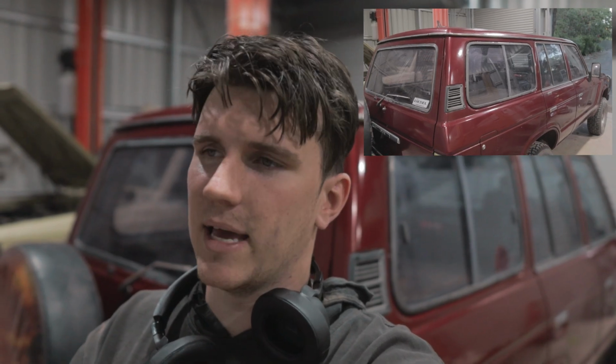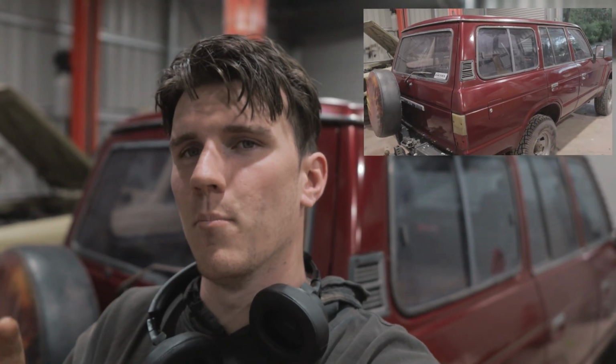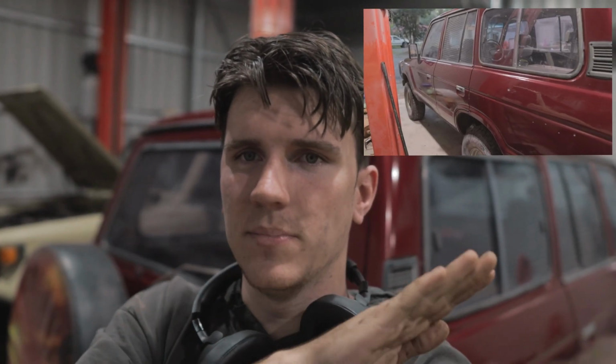There are definitely spots that aren't good at all. And one mistake that I did make is when I was sanding, it was super hard to get through the paint. So I used the sort of edge of the sander to really cut through that paint. But what that did is it creates lots of ribs along where I cut through, so it looks really bad. I won't do it next time because I'll make sure I have a good air sander. But if it does do that next time, I got to make sure I get rid of that in the primer with a straight sander.